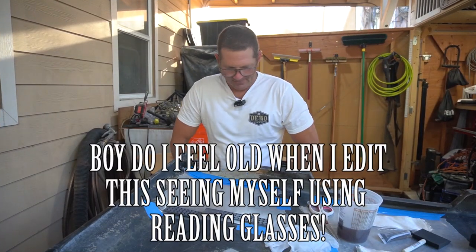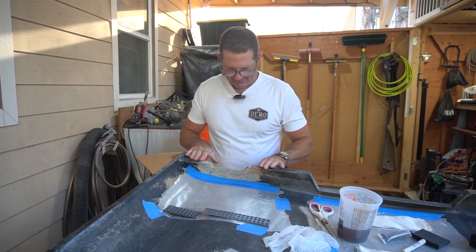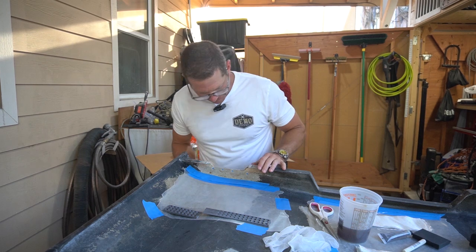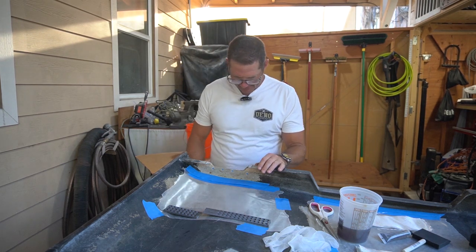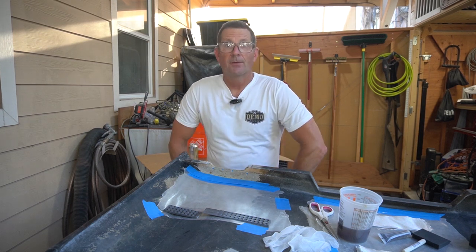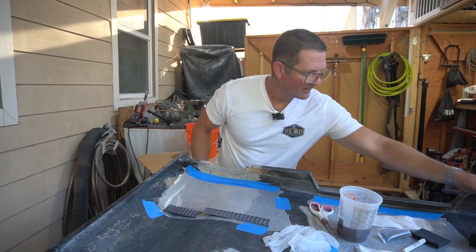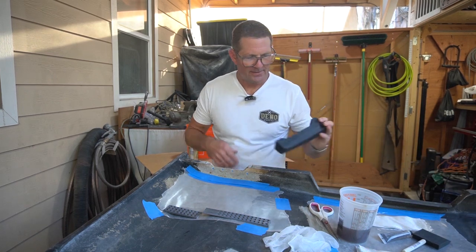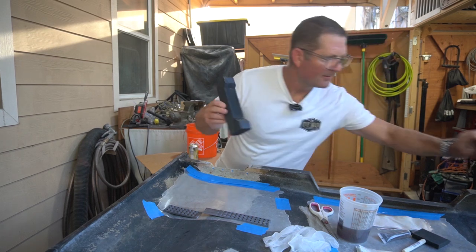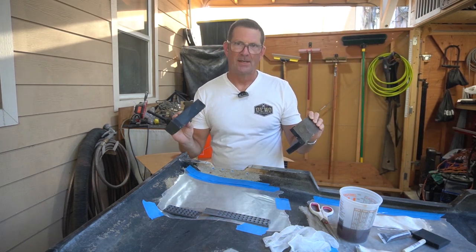Okay, well, getting ready to do my first fiberglass repair. I've got this damaged section cut out and ground down to some clean material, and then I've wiped the surface with alcohol, and I've feathered the edges somewhat as much as possible. And then I've got these forms printed and modified to fit.